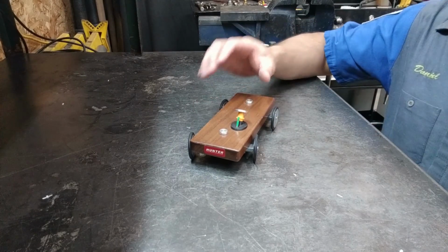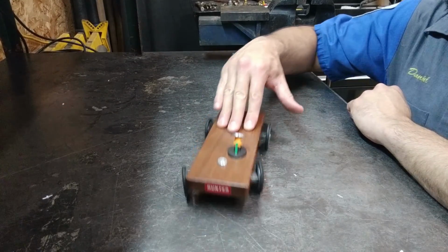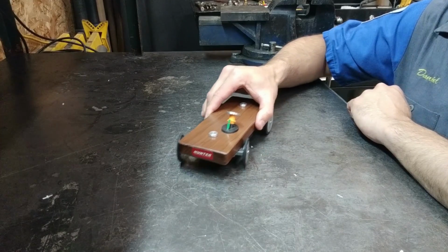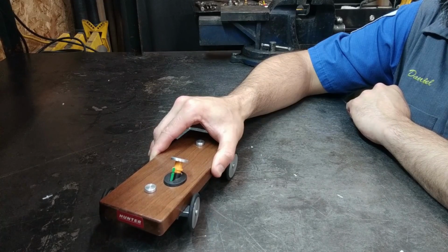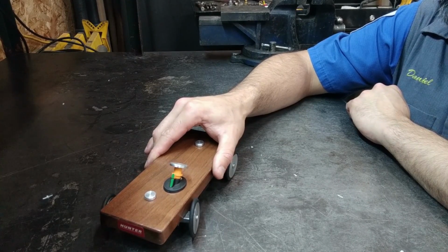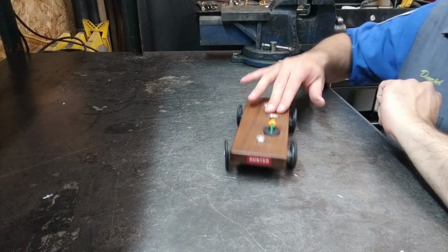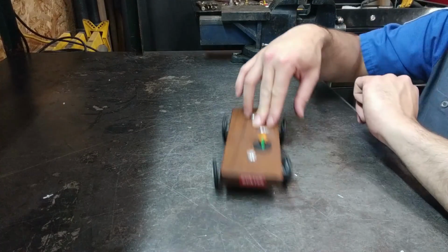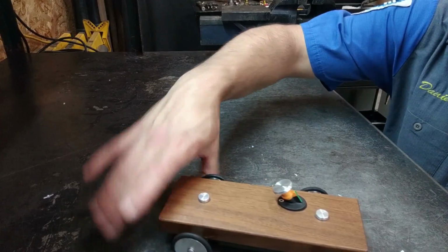So this would mean that all inputs to the system are intending on this direction of turn. But if the vehicle was going straight with the steering wheel position turned and the wheels turned, the sensors that are determining whether or not the vehicle is going straight are going to send that information to the control module. Oversteer is turning more than intended. So if the driver is intending on a certain amount of steering, oversteer would be if the vehicle is turning more than the driver had intended.